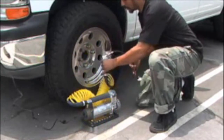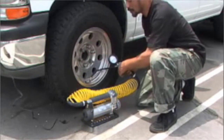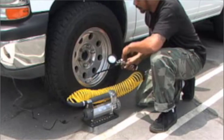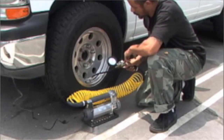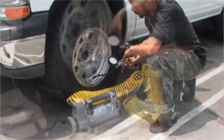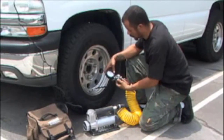the unit will continue to run for a short period of time, but no air will flow into the tire unless you squeeze the trigger on the tire inflation gun to allow the compressor to put air into the tire. Squeeze the trigger on the tire inflation gun. If you do not squeeze the trigger for a few seconds, the compressor will shut itself off. This is the automatic function of the compressor doing its job by reading the air pressure in the airline that is built up to a pressure of 145 PSI internally.